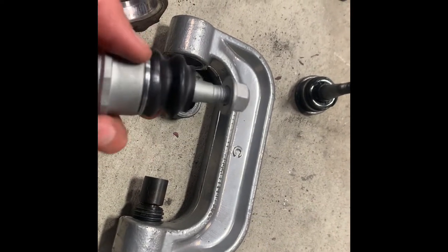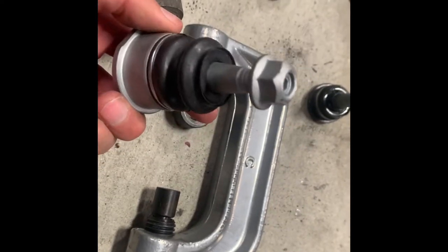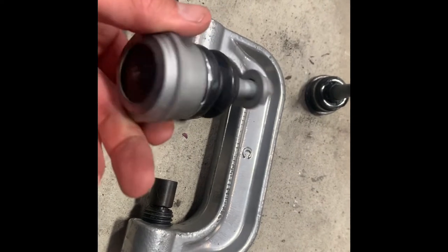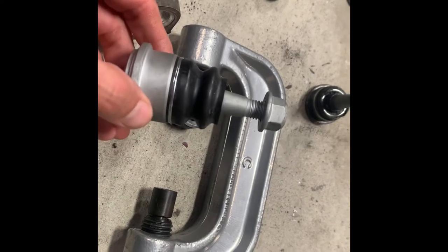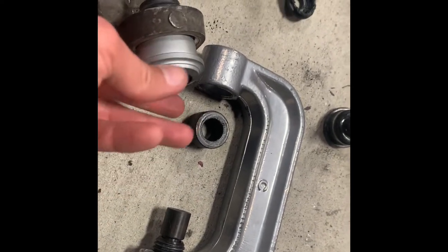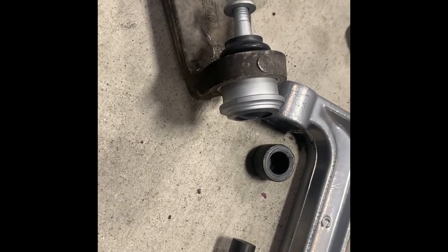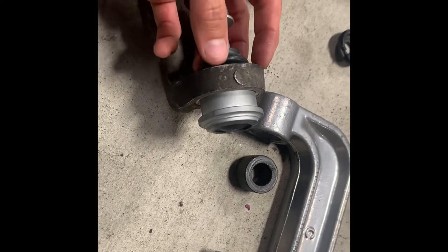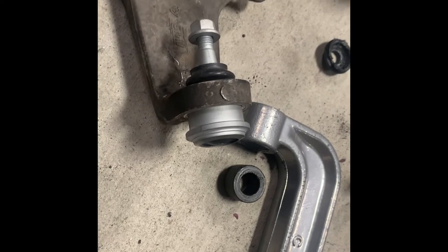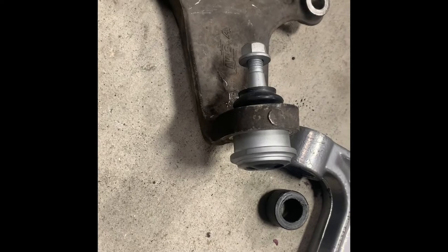That's going to take a little while to get here. So for the sake of moving this project along, I'm going to go ahead and just install these so I can get the car together and get it aligned. At some point later on this year, I will be doing this project again to get the right ball joints back in. To complete this, installation will be the opposite of removal — I'll just put the right size cups on, give myself a little bit of room, and drive the ball joint in. Nice and easy, just making sure it lines up straight, but they generally go in pretty quick and easy.